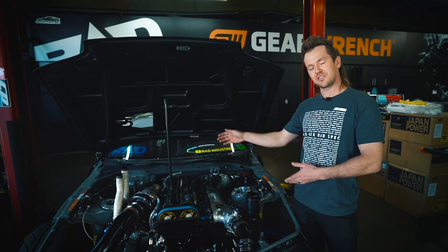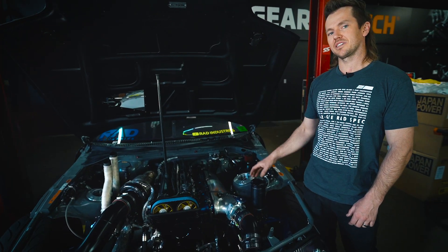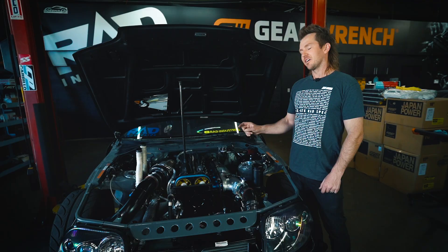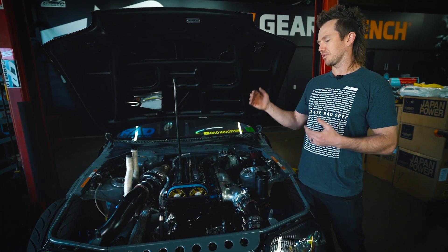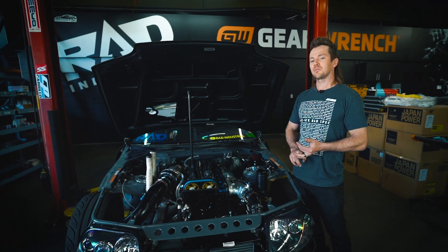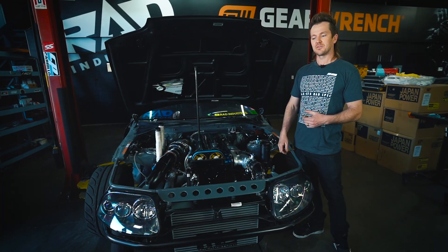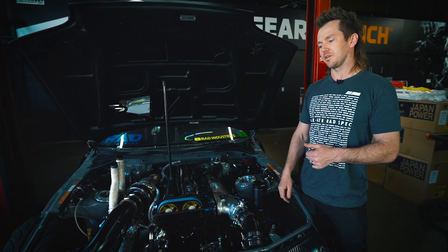So first let's start with the motor. It's a 2JZ motor — you guys probably already knew that. Came stock in the Supra. This one has been stroked so it has a Brian Crower 3.4 stroker crank — I run the lightweight stroker crank that's deep down inside there, we can't see that unfortunately. Then we run Carrillo HD rods, which are good for over a thousand horsepower, up to around 1800 if you push them. I just kind of overbuild it so I can be really mean to it. I run custom 11-to-1 compression CP pistons, which probably wouldn't be good for everyday use but they help spool the turbo and help with quick response. I run Ignite race fuel so there's no issues with the high compression and the turbo on top.